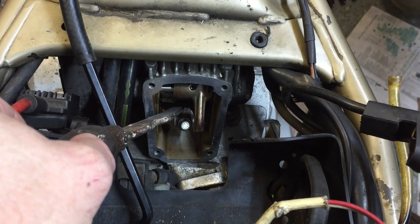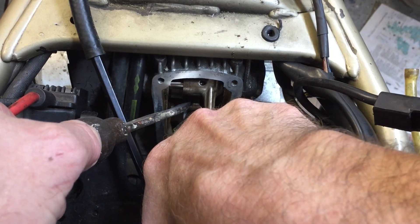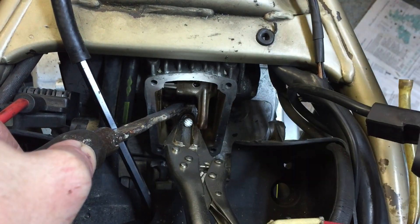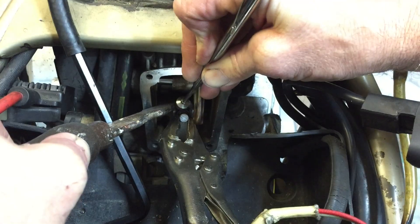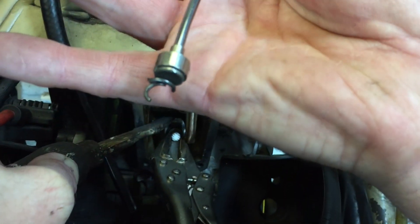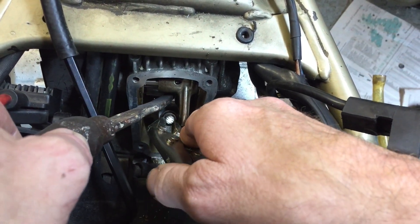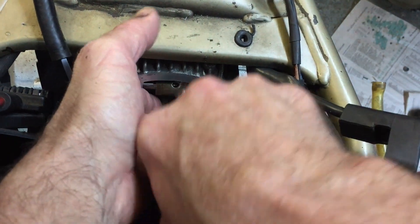You remove the closing shims in a similar way with a screwdriver. You push down on the rocker and then turn the engine until the rocker starts to move downwards. Then you get enough clearance to push the shim down and remove the wire collets from around the valve, which then releases the shim. Just be careful to hold onto the valve behind the shim whilst you remove the shim. And then afterwards just clamp it with some mole grips to keep it secure so you can work on the other valves.